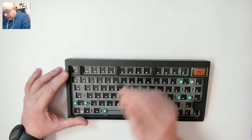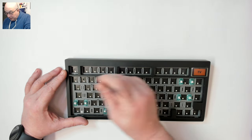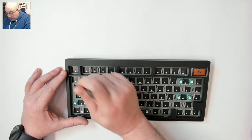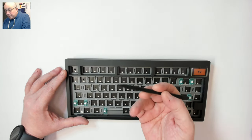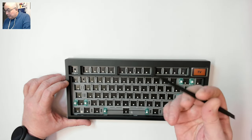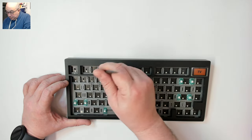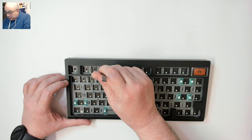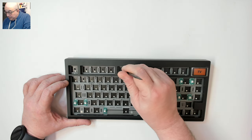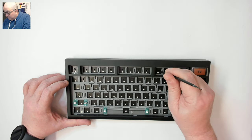But even the IXPE foam does not have the punch outs already. Now most pins will go through the other ones, but I highly recommend just punching through. I like to use a plastic spudger, that way I don't have to worry about puncturing the battery or anything underneath. And obviously don't use much force. Just don't press too hard. It's pretty easy. Punching out that center post ensures that the rest of the pins are gonna go in there nice and easy.